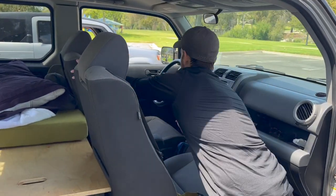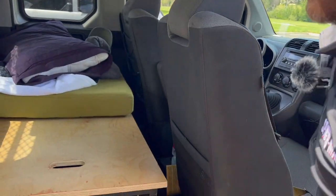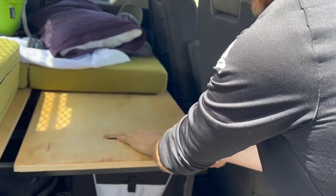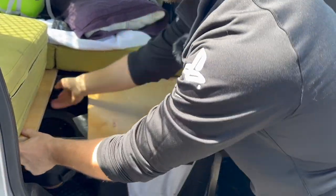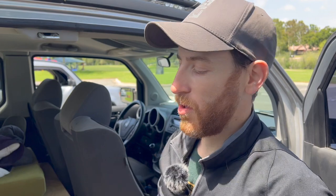That channel also allows the panels to slide apart and extend — that's how we get the extra space. Move the seats all the way forward and you can slide the panels forward, spacing them out. You get a small gap between the panels but when the mattress is on you don't really feel it — slat beds work that way. There's no center support but with three-quarter inch plywood and just two of us, we haven't had any panel breakage. It's a little flexible but that lends to the comfort.